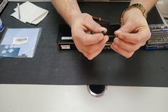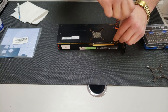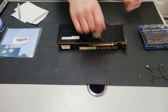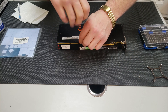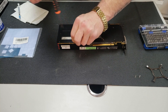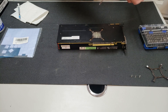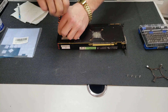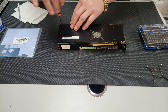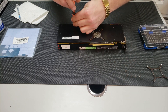There are spring-loaded bolts — springs on the bottom of these screws — so we'll try not to lose them. We're going to have to take this big back plate off. I strongly advise you to pattern out your screws so you know where they came from and you don't cross-thread anything. Almost definitely all these screws will be the same size, but I've still had issues getting screws to go in straight if it didn't come from the right hole, especially with any Loctite or threading protection. You could end up forcing it in crooked, or bulging a piece of plastic out. We're not LTT here, so we won't be doing that.